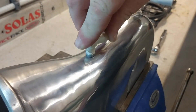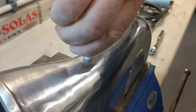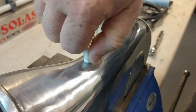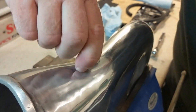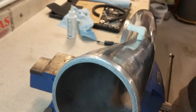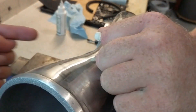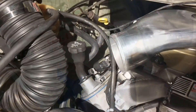All right, so we have completed it. That is an eighth-inch pipe thread to a three-eighths hose barb, which will mate up with the same size nipple on the LS valve cover perfectly. That'll point straight down — the hose will literally come right from under it, plug in, done.